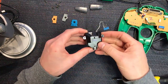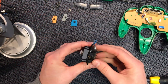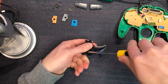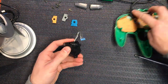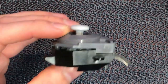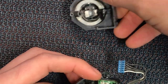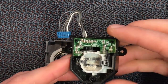That all comes out. The shinier gold-colored screws — those three are the same; all the others were black, so you can keep track of those. There are all sorts of bugs and stuff in this one and this stick is really wobbly, so it definitely needs some attention. Let's take out that final fourth screw and pull that apart — it's a little black one, the same as the one that went down the side of the connector. The whole thing is going to start to spring apart, so pay attention to how it all sits so you know how to put it back together. Squeeze it on the top and open up the little clips on the back, and the whole thing will just lift up — we're left with a powdery mess inside. This one's actually really bad, probably one of the worst I've ever seen, so it's a good example for today's video.